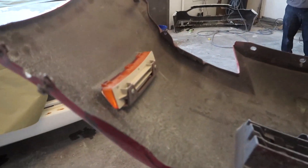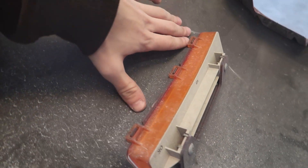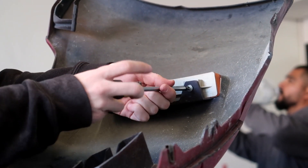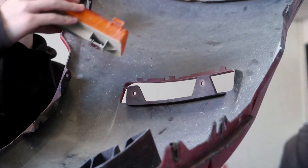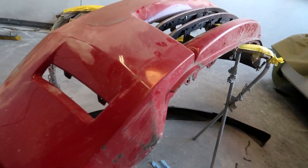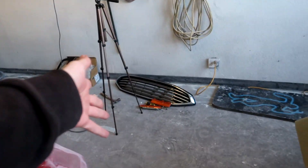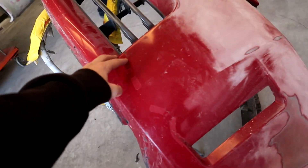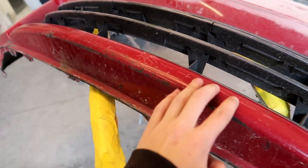I flipped the bumper over and I'm basically going to take these fog lights out — looks like it's just two Phillips screws and three clips here, so it should be no problem. It looks so bare with no front lights, which is kind of crazy. I also took out the reflectors — for some reason I always thought those lit up, but they don't; there's no electricity going to them. So I'm basically going to take the DA sander and hit the rest of it, get all these little scratches out, and then shoot it with primer.